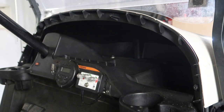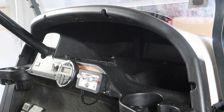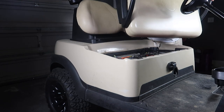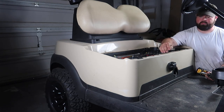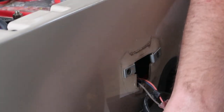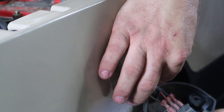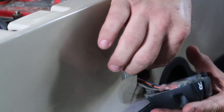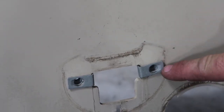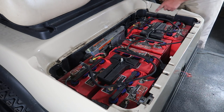Next up, add the eyebrow back to the body of the golf cart. In order to replace the rear body, we need to take the seat off and remove it — lift up, pull up, and remove. Next, remove the front-rear selector switch using a T25. Once you remove the switch, you'll have a group of wires: on my golf cart, probably the same as yours, brown, orange, and blue. The blue is on the F side and the brown is on the rear side. Remove these wires. On the old body, remove the clips if your new body does not have them. Underneath the seat there are four bolts to remove — these take a T30.